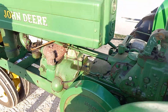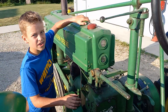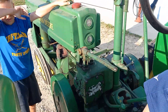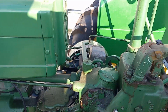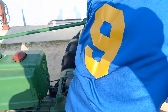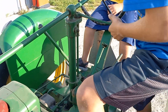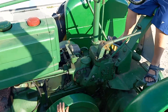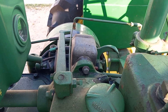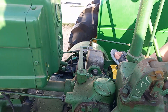What's the next step? I don't know. It's like gas maybe? Yeah, I don't — put a little gas there. How can you see? There's no way you can see gas in there. Yeah, I can see that. It just won't start if there's no gas. So what do we do with this thing over here? You're right in the way of the shot here — I'm trying to do some cinematic excellence. I don't think your foot's supposed to be up on the engine when you're moving the throttle. So you didn't move that enough. If you look at that little piece there, you want to move it until you get about a quarter inch between that and that. That's where I found is about the best spot.